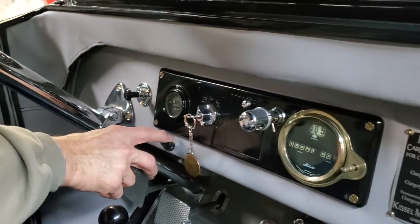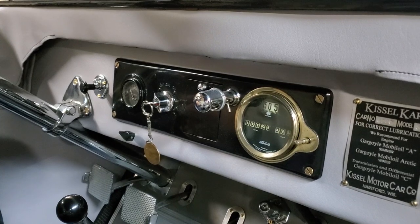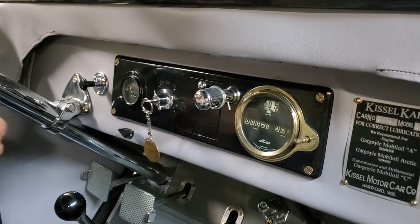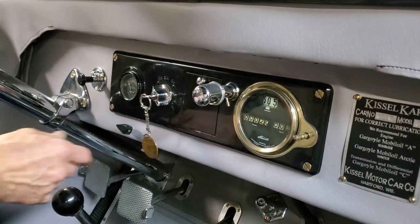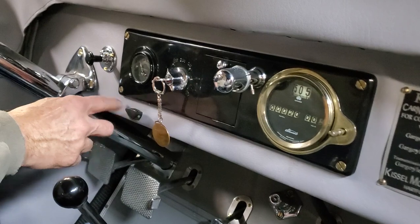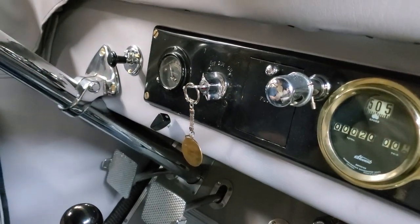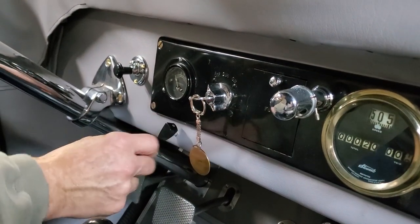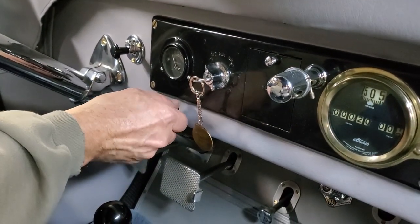This is your valve we put in for the fuel. It has an LB1 carburetor on it that is correct. That carburetor, though, will continue to drain gas on the ground unless you have it shut off. For fuel flow, it's in the off position when it's pointing towards the steering column. The on position is pointing about like that. It's close to straight down, a little bit off straight down. This is on. You have to have that on for fuel flow.